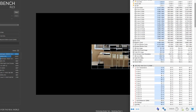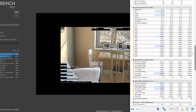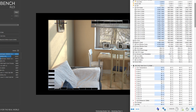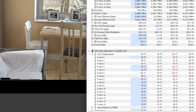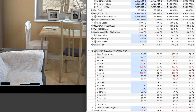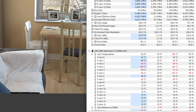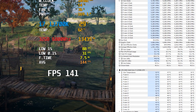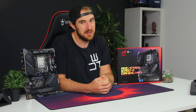Now as for cooling, I did pair it up with the Waterforce X240 — a 240mm AIO — and I did have a hard time actually cooling the i7-13700K, especially in some of the more CPU-intensive benchmarks. My ambient temps were relatively low at 21 degrees for summer, but even with the fan set to max at 3200 RPM, it still hit the high 90s and even 100 degrees Celsius. Because of that, it did slightly thermal throttle down to an average of 5.1 GHz on the performance cores and 3.9 GHz on the efficient cores. In games it was better, averaging around 60 to the mid-70 degrees depending on the game. It looks like you would need something like a 360mm AIO to actually keep these CPUs in check, or extremely low ambient temperature — which unfortunately here in South African summer we don't have the luxury of.